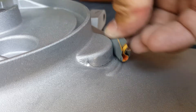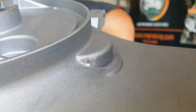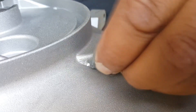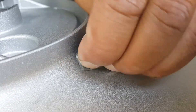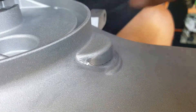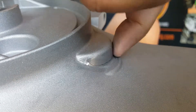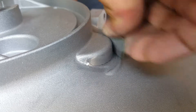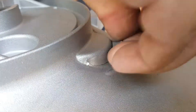We're giving it a good sand down. It's going to have a little gray tar-looking residue — not very pretty, but it's going to do the trick in the long run. We're aiming for performance and aesthetic as much as we can. We could even paint over the JB Weld. The main thing is to get it on there, using gravity to our advantage by tilting it so the JB Weld gets into the crack. We want to sand the area really well because oxidation is what we don't want.